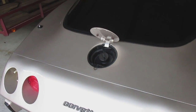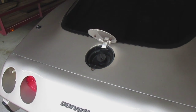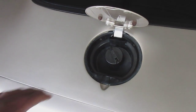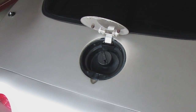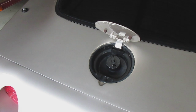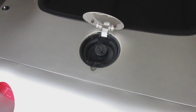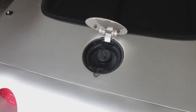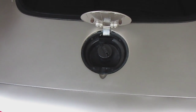I decided to make a follow-up video on the video I made yesterday where I was talking about installing LED tail lights on my '78 Corvette and repairing the fuel gauge fuel level sender. As you can see, I already got the fuel level sender installed, got the new boot in there, got a new gas cap, and that fixed the problem — my gauge works perfect now. I was kind of surprised I was able to get that sender out through that hole, and the biggest thing was putting new hoses on. There's a short little piece of hose between the fuel lines, vapor lines, and the actual sender unit itself. It's kind of tight in there — you have to really get some light on it and work with it little by little, but you can finally get it.